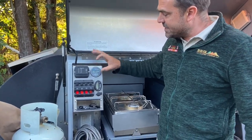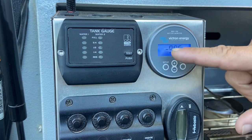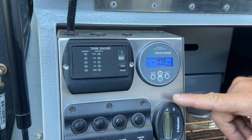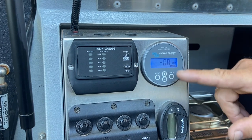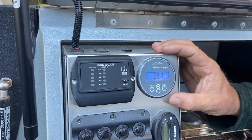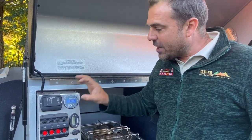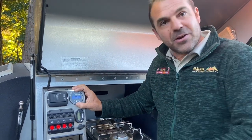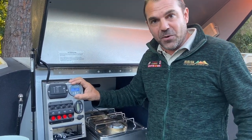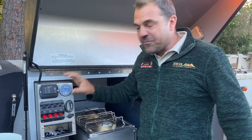Our digital battery monitor shows we're drawing power — 12 volts in the battery, using nine amps to run the lights and the glow plug for the hot water, which converts to about 100 watts. We've used just one amp hour. Battery is at 99%. Remember: AGM batteries — 50% is empty; Lithium batteries — 20% is empty. On AGM, you can draw 100 amps from a 200-amp system. Anything above 12 volts is good; 11.5 volts is quite low.